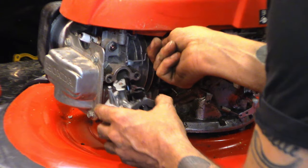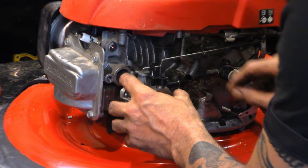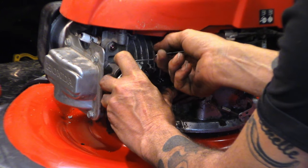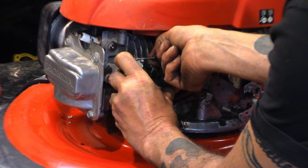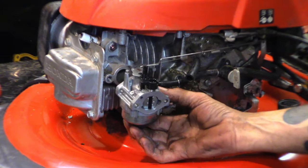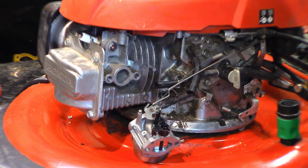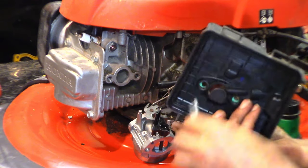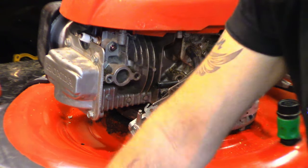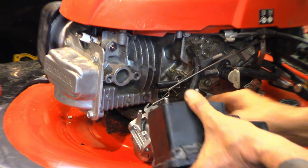Let's get our linkage hooked up first, because everything has got to be sandwiched together. So there's our governor damper spring. Get that hooked in there. Okay, so that's there. Now there's a bunch of gaskets we got to sandwich together. So first things first, let's get this gasket in there. We get the bolts put through, because the bolts are what's going to have to hold everything together in alignment. So there's that, and that slides through the carburetor,